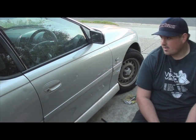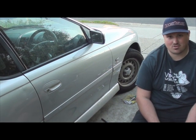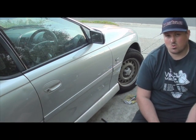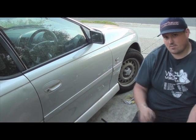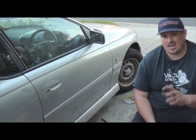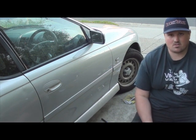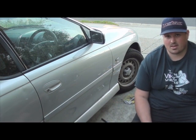The new door's back on. It wasn't as fun as what I thought it would have been, but then it never is. The hardest part would not have been removing the pins - it would have actually been getting the door off by yourself. I did actually need a hand from the wife. I did have the pin on the bottom hinge of the door break on me. So what I've done is I've just put the larger of the two broken halves in that bottom pin section, because obviously I didn't have any spare pins with me. Easy fix - whenever I get around to getting some more pins I'll just take that bottom one out and put the new one back in.